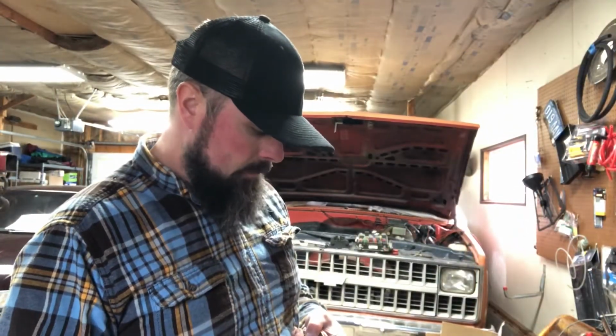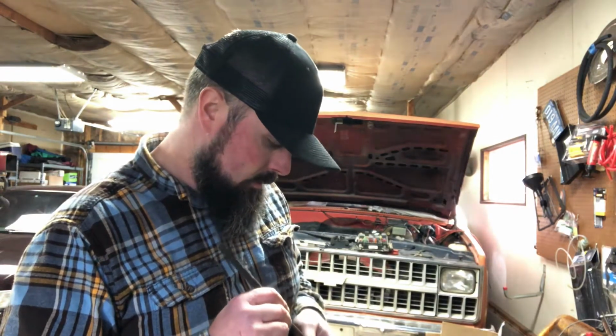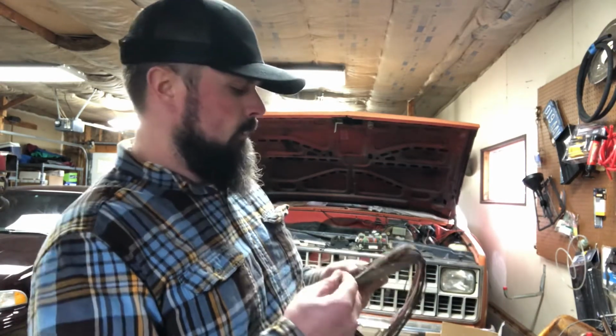Is 25, which is O2 sensor, signal low with case ground. It's highlighted yellow. I'm just going to pull it off and see, it's a tan wire. Yep, tan wire. There's actually 2 of them that I can remove.